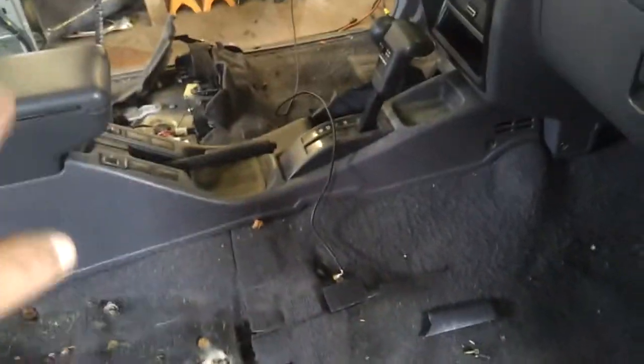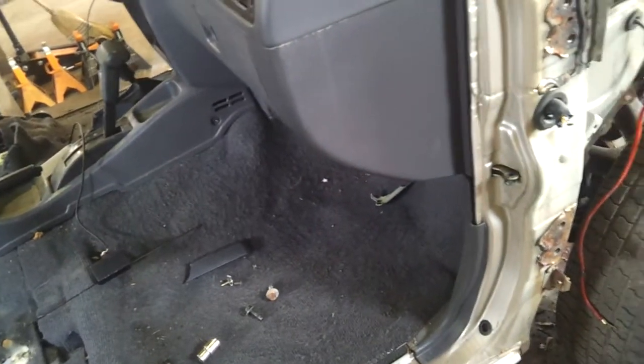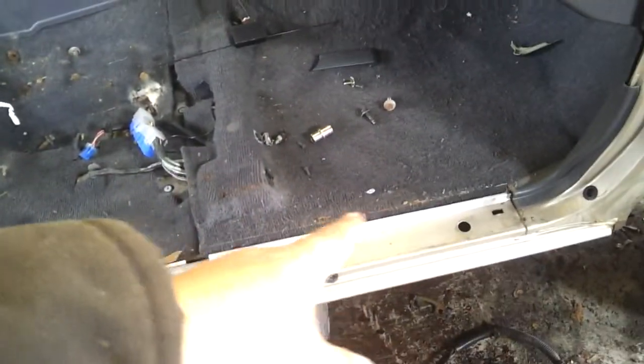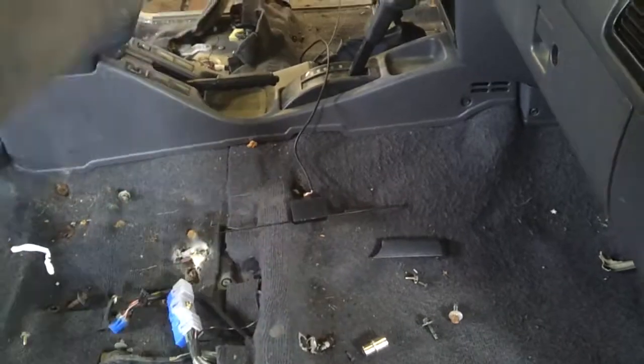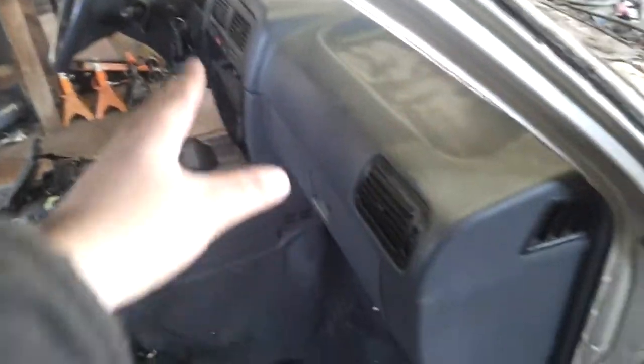By the end of tonight, my plan is to finish getting the carpet, center console, headliner, sun visors, and rearview mirror out of here. I'd also like to have the body cut off — I need to find the body mount location, cut just on the other side of it, and then cut the roof to roughly this point. I don't want to cut too close to the dash because I plan on keeping that, so I'll take everything rearward off and cut it into manageable pieces.